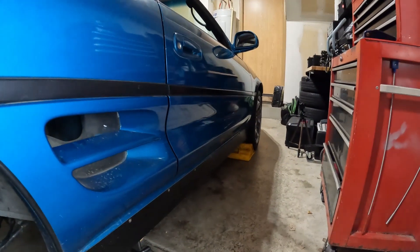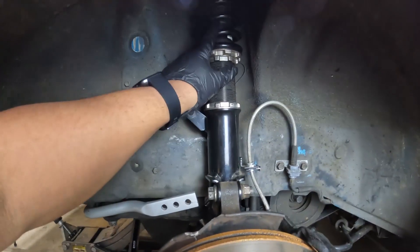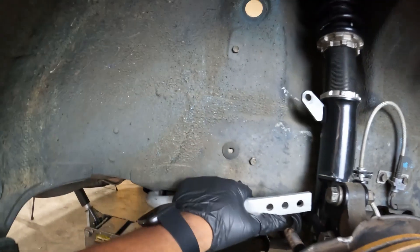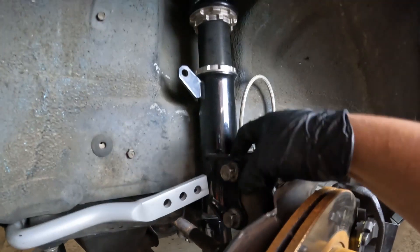Since the last clip, I got the front of the car on the ground and the back on jack stands. We're going to replace the springs on the back. I already did the driver's side rear and driver's side front two days before filming this video. I will actually be removing the rear sway bar. The motivation behind raising the spring rates is that I really like the setup without the rear sway bar, but with the softer spring rates it had too much body roll. I also didn't have the suspension geometry kit on the car at the time. Between the higher spring rates and the suspension geometry kit, I'm feeling confident I'll be able to run this car without the sway bar.